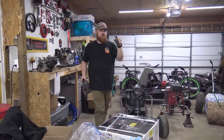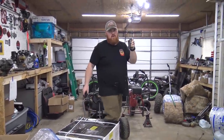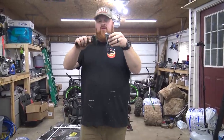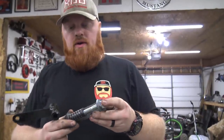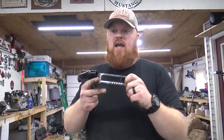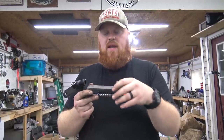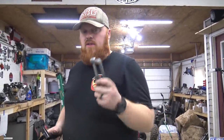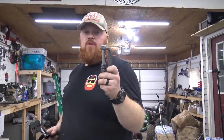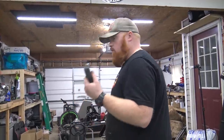For people that don't know — on the front of a go-kart you have spindle mounts welded to your frame and the spindle goes in between there. This is a Springer spindle — you can see the spring there — which gives you a little bit of suspension like on a yard cart. I use these brackets all the time; we cut them down, weld them back together, and weld them to this back engine frame to give a pivot point. They're super thick — like a quarter inch thick steel — and they work really well.